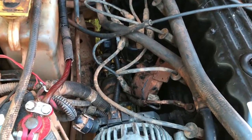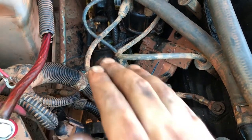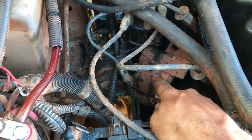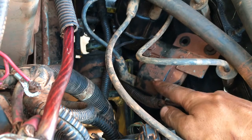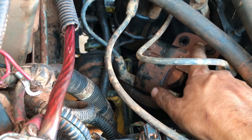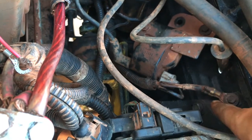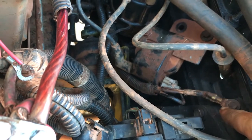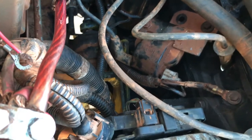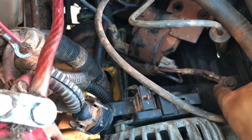All right, so a couple other things that are different that I totally forgot to mention. This is the coil pack. This is not where it's supposed to be, but I just found a little bolt and a mounting hole, and this is how I have it wired up. The ground mounts for the wiring harnesses for the XJ are different on the WJ 4-liter. So I just found some places to stick them on the motor.